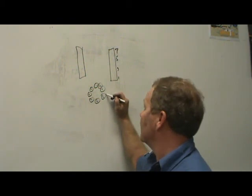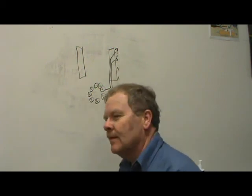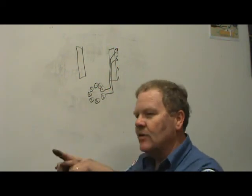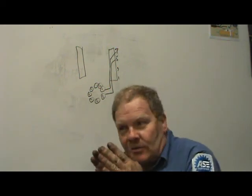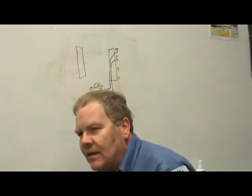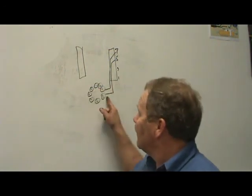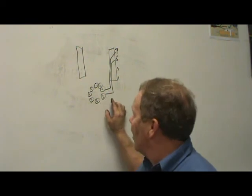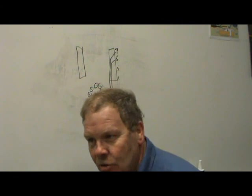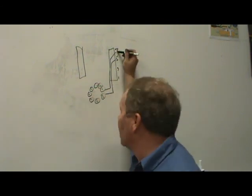5 and 7 are next to each other on the distributor, and they're also next to each other on the engine. When you run those two wires right next to one another all the way down, and you say, I'm going to be a good mechanic, I'm going to run these wires real straight in this loom, and they look real pretty going over there, then all of a sudden you've got induction crossfire. That's the answer to that question, because this one fired right before that one did. And all the way down that wire, it has created a spark in the other wire because it's induced it.